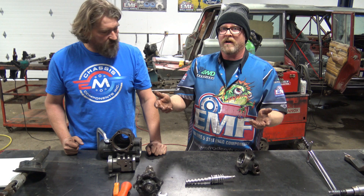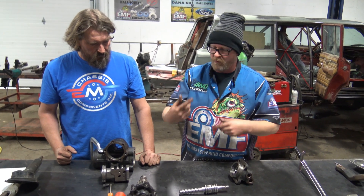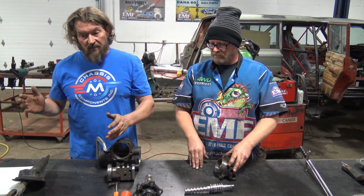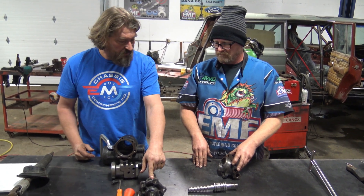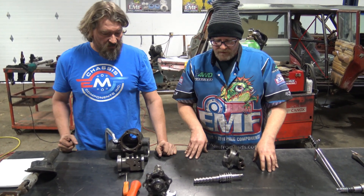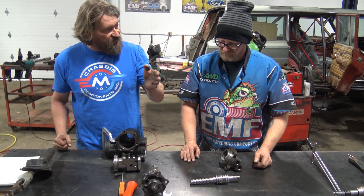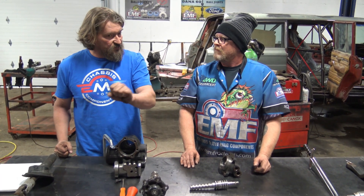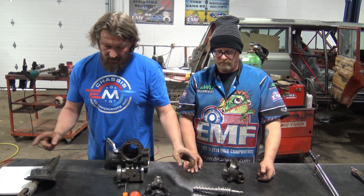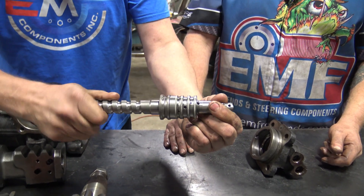Yeah, or if we could shut the hydraulic flow off — because we think it's the combination of pressure behind it with the mechanical actuation that starts the chain reaction. Now you have to have something that starts it, like a bad tire, a poorly balanced tire, a poorly worn tire combined with a bad bushing which allows slop, or too much lash in the box on an old truck, or bad drag links — bad drag links are huge. Anything that's going to allow the tires to be free from everything else. But it always seems to happen under throttle, so your pressure's up and your flow's up, and usually when you're turning corners — so you've already opened one side of the valve and you've got pressure on one side. When you hit the bump and it flutters, it allows the valve to go from left to right quickly, and then you get the flutter going and it just keeps hammering.